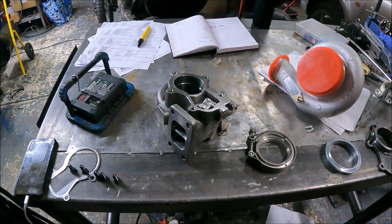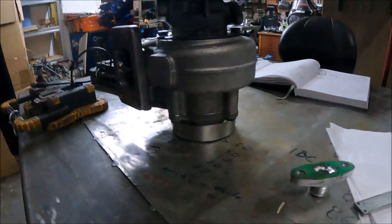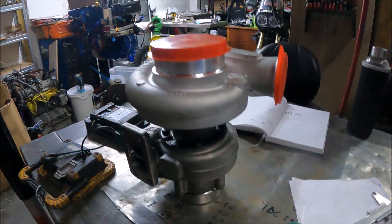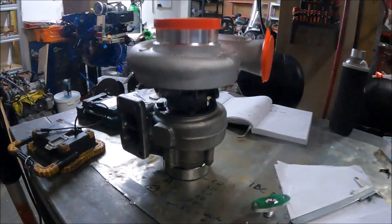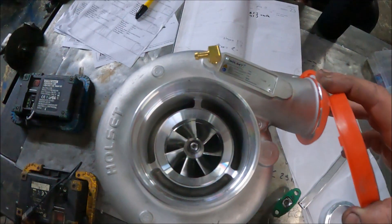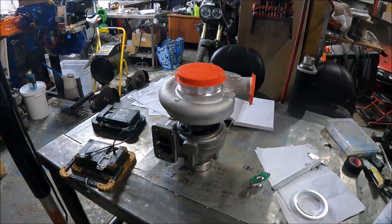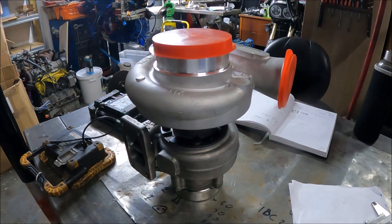Short video just to explain all that — and now I'm going to put this part together. This is the turbo now with the V-band on it and all the work done, and I think it looks far better as well. Having the lugs removed just makes it look like a smaller, neater turbine housing. It's a properly good turbo — fancy billet wheel loveliness, and best of all it's got a really good turbine wheel too. That actually has a bigger effect than the compressor wheel fanciness — it's the one thing everyone ignores.